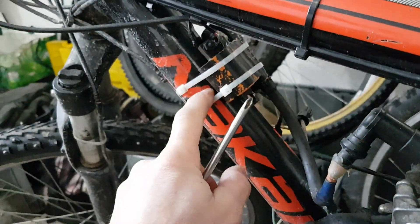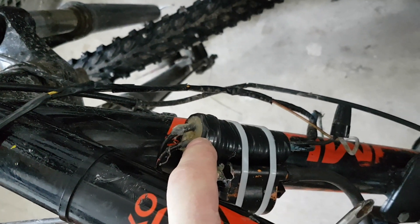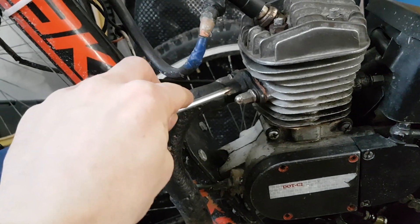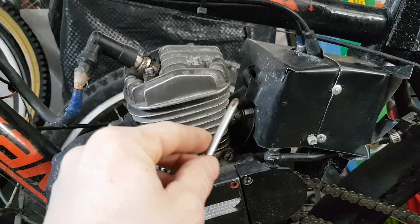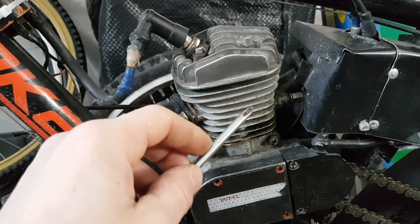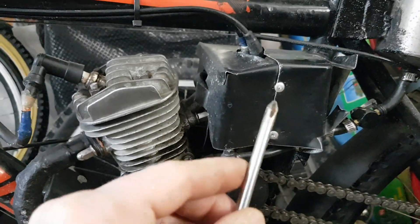This is the bike I'm going to be tinkering with. It's got the rocket racing CDI in the pill bottle. I've never really had any issues with it. Over the years I made a nice pipe — it's all honed out real nice and big. The ports are all big going into the exhaust, the intake is the same way. I lowered the intake port, raised the exhaust, raised the transfer ports a little bit. Beefed up the carb, honed it out, and jetted it.